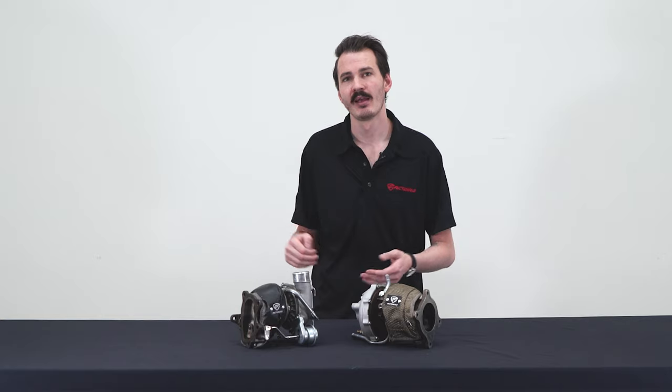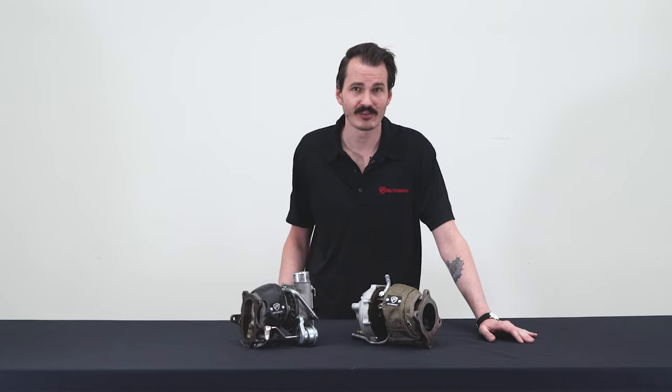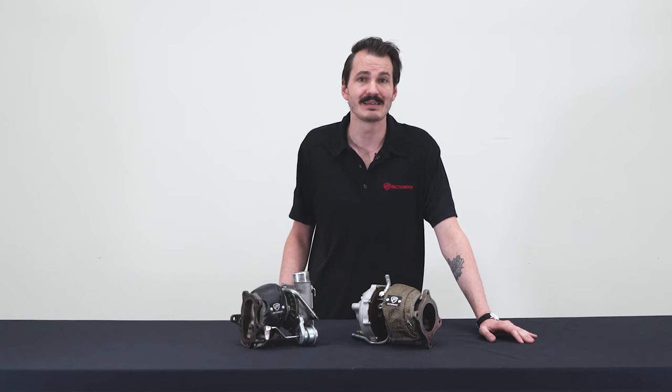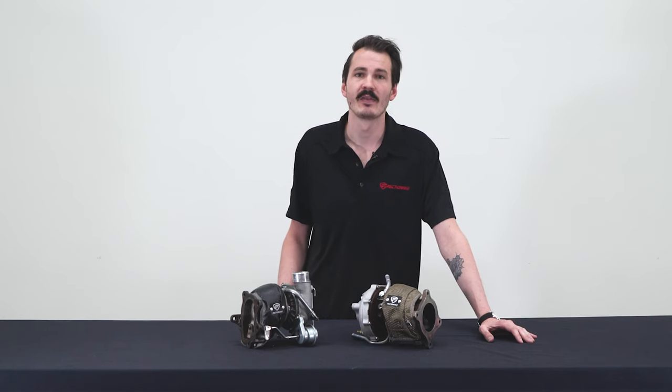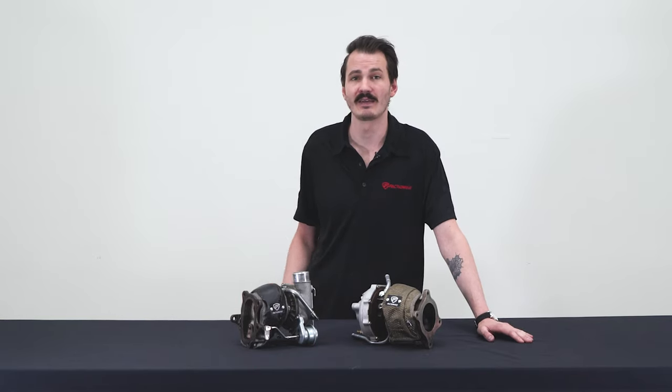This is the purpose of an intercooler. But the air coming out is a different story. If you can keep the air hot as it travels through the headers and turbos, you will have more volume and will maintain a higher air velocity through the turbine, which leads to a quicker spool time. The turbo blanket is huge in helping both of those things — keeping heat in the exhaust side and preventing heat soak in the intercooler.